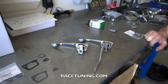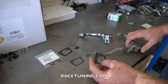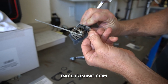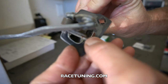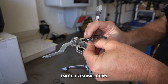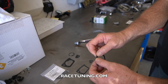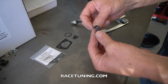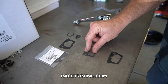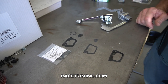I wanted to talk about the difference in the gaskets. If you're restoring your car and want to keep it as original as possible, look at stuff like this. Here's the original gasket that came off — it's not perfectly round, it's kind of square-shaped so it locks onto the stud and locks the door handle in place. That's a hard plastic, whereas the one that came with the aftermarket door handle is rubber. When I replaced the handle on the other side, it actually started to squeeze out and I had to take an exacto blade and slice it around the paint job.